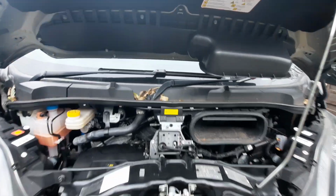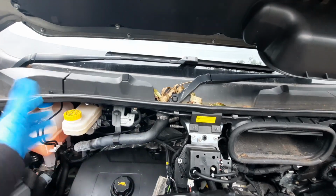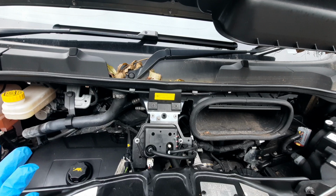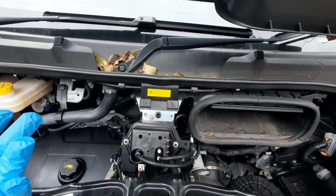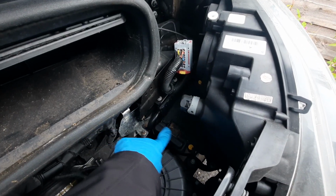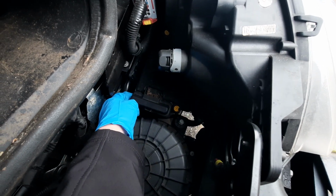With the bonnet lifted, you'll be able to see obviously your engine oil, your brake disc fluids and things like that. But the main thing underneath here that you need to know is if you're ever needing to jump start the vehicle. If that is the case, you've got your negative point, which is on here, and then your positive point is just underneath this cap here. On the cap it has a positive sign here, so you know obviously where it's located.